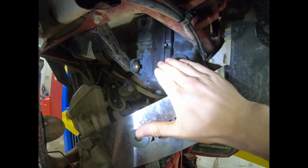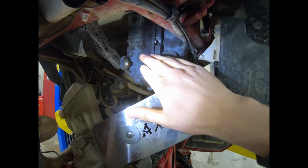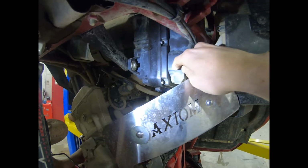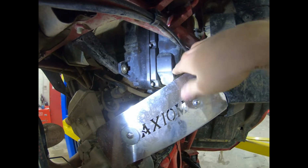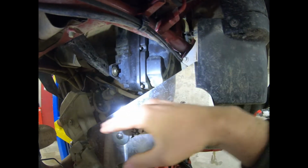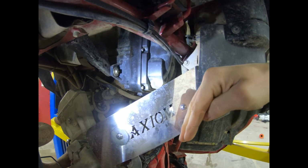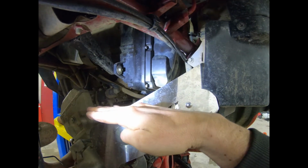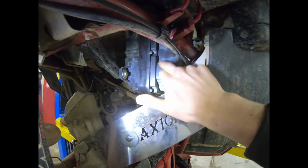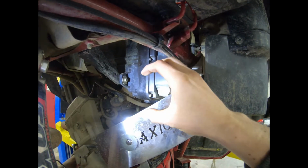But to install this is kind of a pain in the butt. Anyway, we'll get to that here in a minute. What this spacer does is it allows the Venturi tubes a little more gap, so the air still has that nice flow coming into the Venturis for the throttle body, instead of coming down, cutting, and then having to go straight across. It also adds a little more volume in here, which creates a better volume for your throttle bodies.